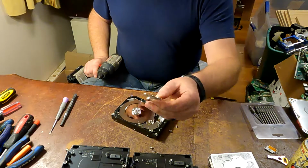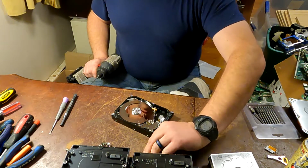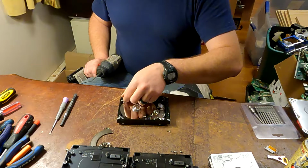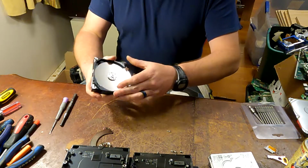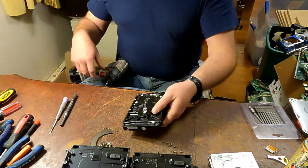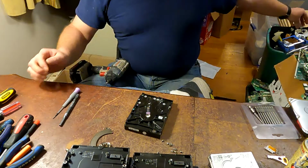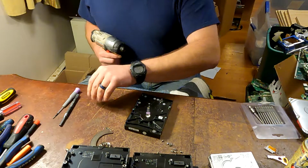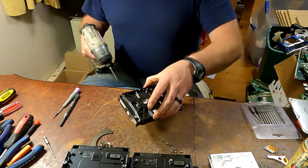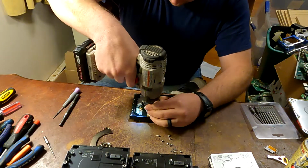So these are normally aluminum. So you can throw that in with a clean aluminum. Test them though, there are some that are something different. This is going to be aluminum. Now, I didn't check. This might be one of them that's got that screw back here. So, looks like it is. So for this one, you can take this screw out right here, and that needle will just fall right out the other side. It makes it a lot easier.